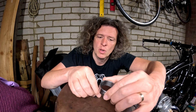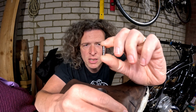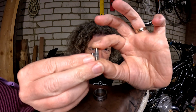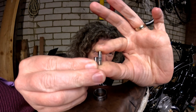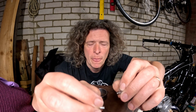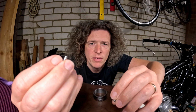So you saw earlier I was mentioning that amount of free play I had on my clutch cable, so I just want to explain why my clutch wasn't working, because it took me a while to find out. You've got these 3 little pins that push out and separate the plates. I've shown you these before in some other video. That's the ones that came with the bike. That's the ones that are correct for a 7-plate clutch. So there's quite a massive difference in height between those two. So I bought these for the 7-plate, correct for my bike. That's what came with the bike. Neither of them worked. And then since then I've bought the ones from the Owners Club that are for the 9-plate clutch, which is what I've now used and managed to make it work fine.